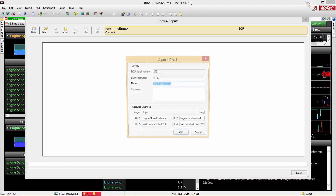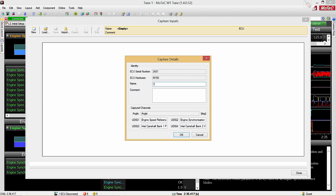In order to run the engine correctly, the ECU needs to know what data it's expecting to see from the engine speed and engine position sensors. This data makes up what is usually referred to as the trigger mode, or in the Motec M1 ECU we're using, the ref sync mode. There are about as many different trigger modes as there are engines, and the first hurdle was that Motec didn't have a mode for the 1UZFE VVTI engine. One of the first jobs we had to do was capture some data from these input sensors that we could send to Motec so they could add an appropriate ref sync mode for us.